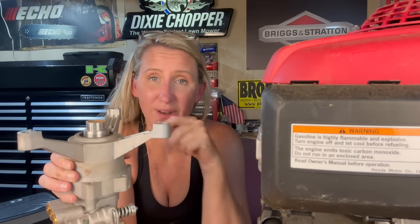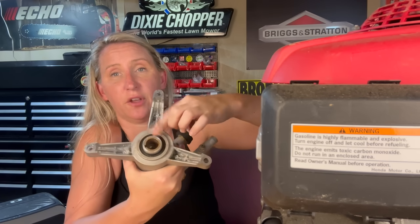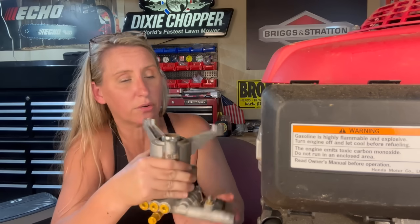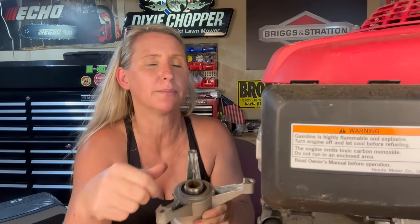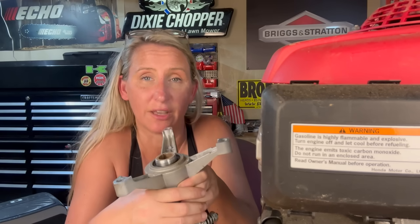These are sealed units so you don't have to add oil to them. It's pretty easy, and doing it yourself is going to save you a ton of time, money, and frustration. One more thing: whenever you go to put it together, you can move the inside shaft of your pump around for the keyway, and you can move your engine crankshaft, so you can line everything up to line up the keyway to where you can see it correctly, then move your legs into place. Once you start to mount it back on, finger-tighten the bolts and nuts. Once you have all of them finger-tight, pull your pull rope a couple times and make sure there's nothing binding. If there isn't, you're good to go to tighten it down the rest of the way.